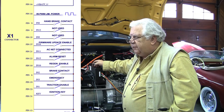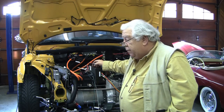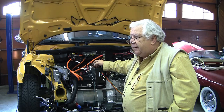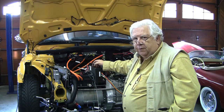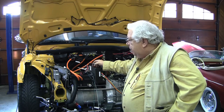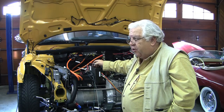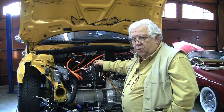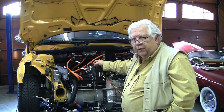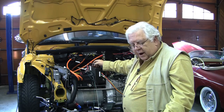Reading through the blogs of many owners, a lot of them have gotten into winter and found themselves on slippery roads. The BMW guys have done something very cunning — they've taken a signal from their ABS system and used it to disable regen when you're on icy or treacherous roads. That's a pretty good idea. I wish I knew what signal that was, and we're going to be looking for it. Since it is winter here, we're going to put a little toggle switch on the dash where I can disable the regen. If you're on glare ice, you probably don't want braking to apply itself when you try to slow down, so I want to be able to turn off regenerative braking completely at my fingertips.